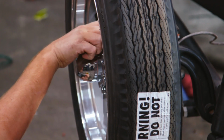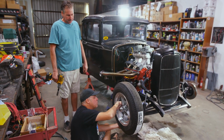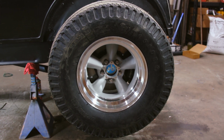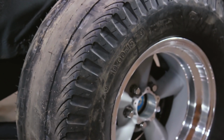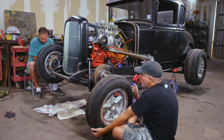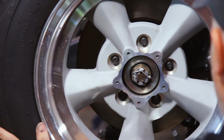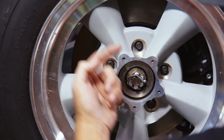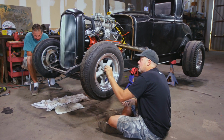The wheels and tires are from Coker. We're gonna have a 560/15 on the front, which is a bias ply Firestone, and on the back it's gonna have a 10-0-15 pie crust slick. And they're on American Racing 15x5.5s and 15x8.5s. The other thing you'll notice here is that these are the straight spoke Americans. It would be like a styling faux pas to have the Torque Thrust D, which by the way means disc brake, because it has the curved spokes to clear calipers. This is the older looking design, even though this doesn't really look that genuine.